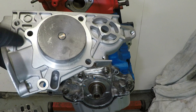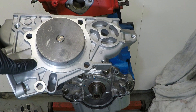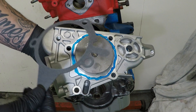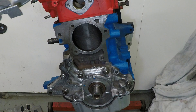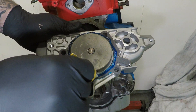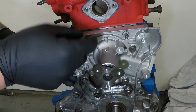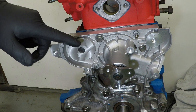There is a gasket that sits here. This step is optional but advised: put a little bit of sealant paste on the face of the water pump and on the gasket itself. The gasket can only go on one way, so it's pretty obvious if you get it wrong. Then a little bit more sealant paste on the other side of the gasket, and carefully pop it on - try not to disturb the gasket. The water pump bolts need to be torqued to 14 to 18 foot pounds.